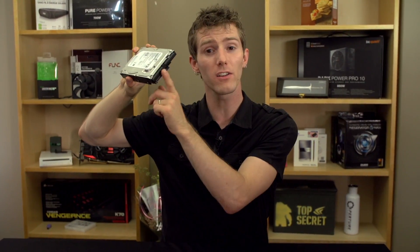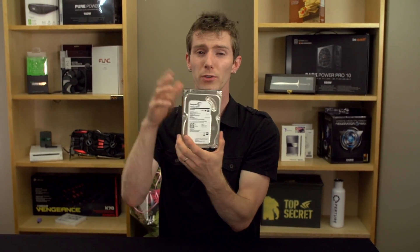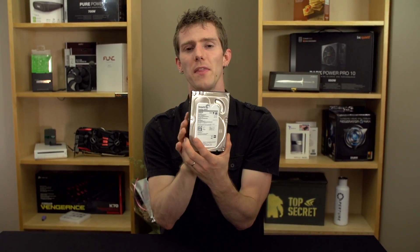This implementation is not the be-all and end-all of a hybrid solution. If you have two separate drives, you can use Intel SRT to use an SSD to cache a hard drive completely separately, and there are drives being manufactured with a single interface that have two separately addressable drives inside them. This is one of the benefits of SATA 3 6 Gigabit per second — you've got tons of bandwidth there, as long as you're not talking about extremely high performance enthusiast-grade SSDs. Microsoft is also working on ways to have the OS handle some of the SSD caching itself, and Intel, Seagate, and Western Digital worked on an extension to the SATA spec that will allow the drives themselves — which really do know more about what's going on inside them than the OS — to start providing hints to the OS about what to cache and when and where.